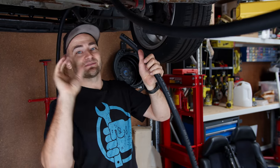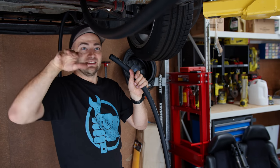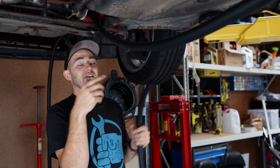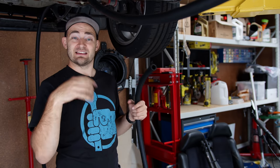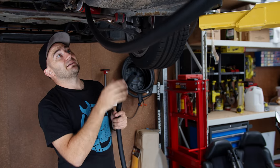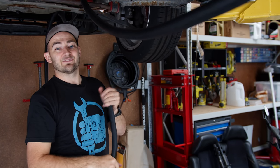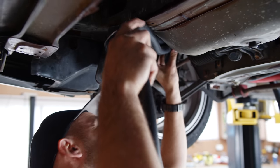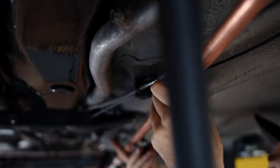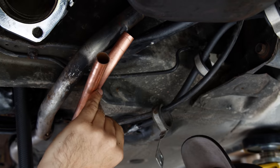Working out this water-to-air intercooling system is tricky. I really want the radiator at the front of the car where all the cold air is, though a lot of people put it in the back — which is pretty cool because you can hang the radiator down and catch the air at the back of the car, so you don't have to run big long pipes. I'm going to use a combination of 19mm internal diameter hose and copper. That's a really common plumbing size so it's cheap and easy to get. It's not cheap because it's copper, but it's easy to bend and work with. The internet is full of arguments about how best to do this. Aluminium hardline is a good and possibly cheaper solution but not as readily available in this size. Copper is a soft metal which is why it's so easy to bend and work with, but will it last long term in the harsh environment under the car? I guess we'll have to find out.